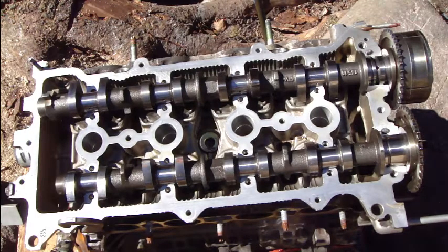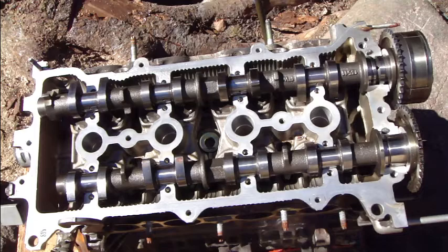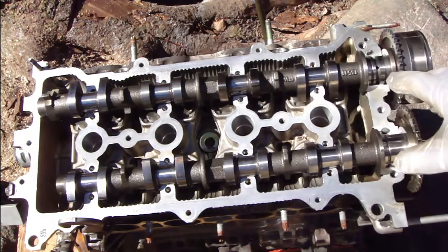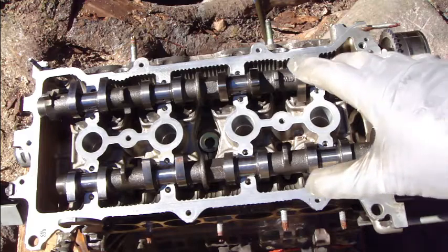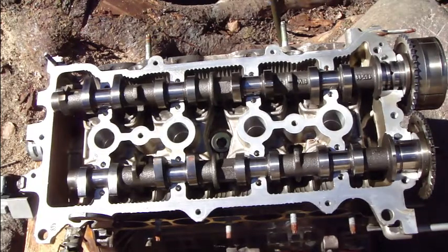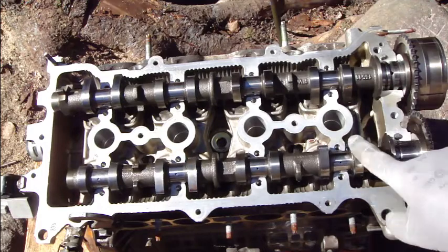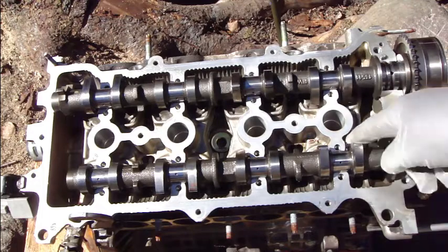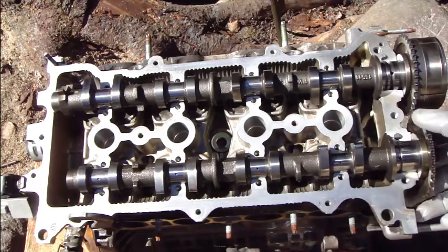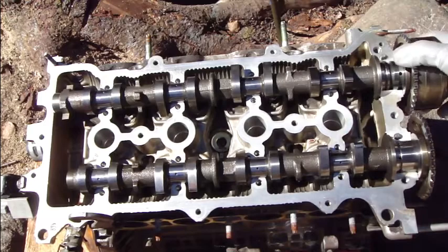In the next phase, when we are starting to install these bearing plates, before that we need to install these camshafts in the right position, in this central adjusting position, and next we will do that. Okay, and then at that stage we install these camshafts so that the upper parts are up in this area, and also here when I rotate, they are in this up position.